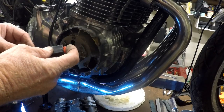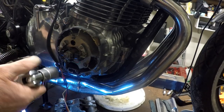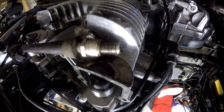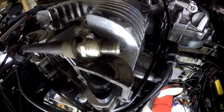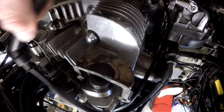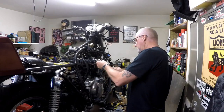Contact — we have power there, and as this swings past it should spark there. Did you see that? Spark! We have spark! I don't know whether you can see that, but trust me when I tell you we do have a spark. That established, let's try the other coil.